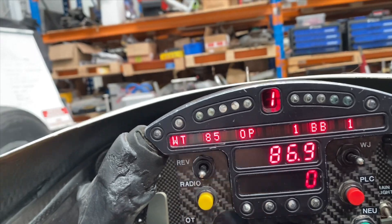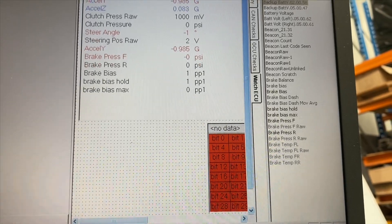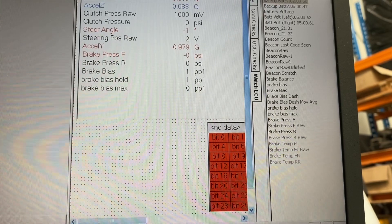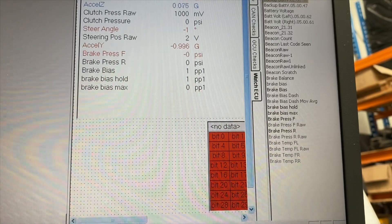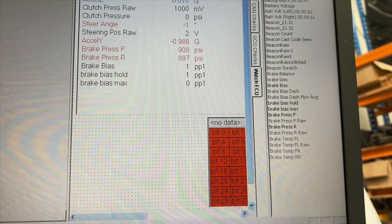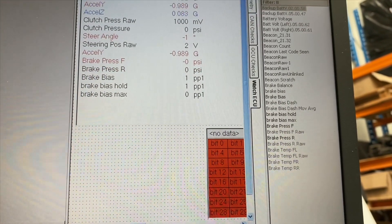What I've done here, you can see, I've brought up the front and rear brake pressures on the laptop. The front brake pressure is shown in red and the rear is in black. When I make a pedal application, you can see it's roughly 50-50 right now.